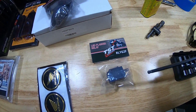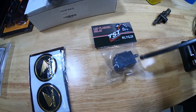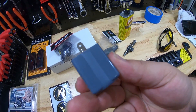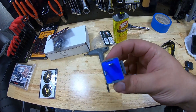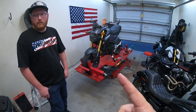Since we did install the integrated taillight, we get that issue where it just stops blinking. So we're going to remove the front of the bike, take the stock relay off, replace it with this one, and it should fix the issue. Pretty easy little part, and it's seriously a super easy, plug-and-play installation. TST Industries sells parts for sport bikes, naked bikes, and the Honda Grom.